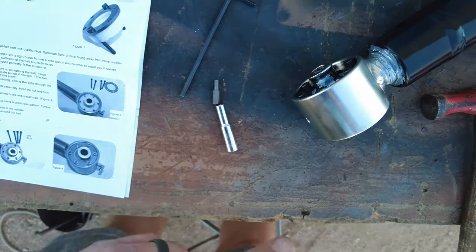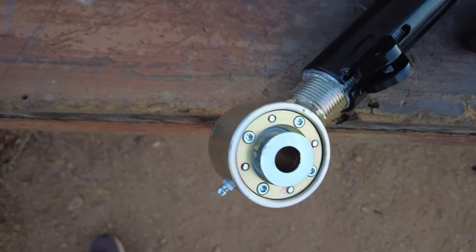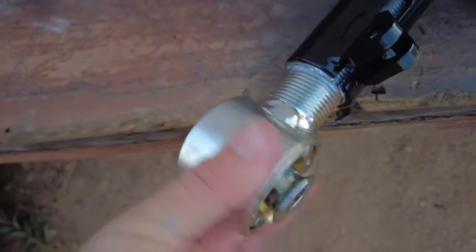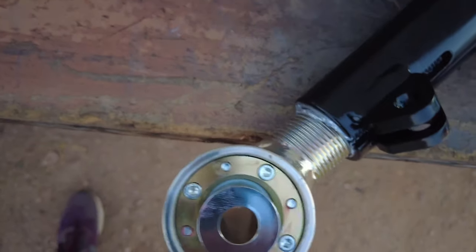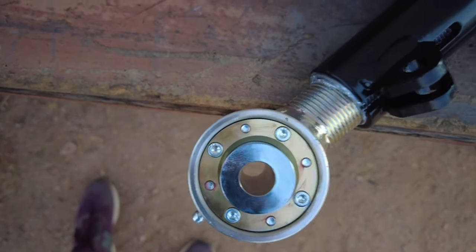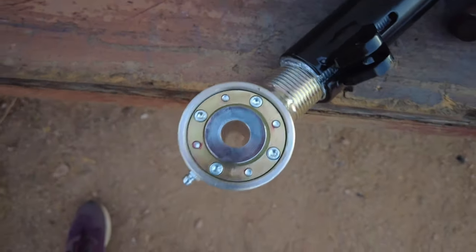The deflection beam torque wrench has a quarter-inch fitting for sockets. You can use a 5/32" Allen wrench in a socket on the end of the torque wrench. For the upper control arm flex joint, the washer on the end is threaded, making it easier — you torque all eight bolts to 50 inch-pounds, then 55 inch-pounds, then grease it, wait five minutes, and re-torque to 55 inch-pounds.